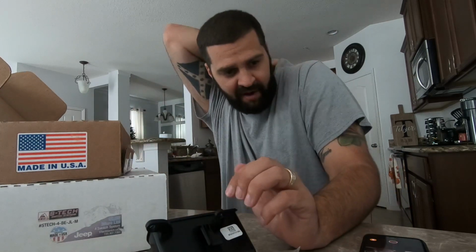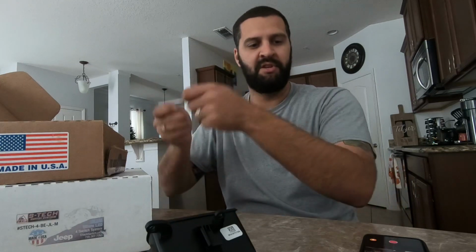10-inch front light bar, and 2 different sets of light pods. One set will be facing forward and one will be a side shot. For those of you who've seen my fender deletes, if you're deciding on fender deletes, something to consider here, you'll see 2 front tabs that we're holding on your fenders. Those tabs are really nicely placed. They're a little close to the body, but instead of cutting there and trying to paint that area, just break the 2 upper tabs off over the fender to get your wheel clearance,